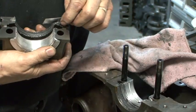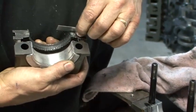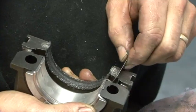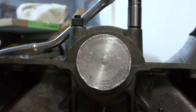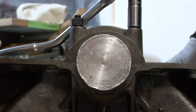You can see Shane's just trimming the excess away from the parting face — you need to do the same thing. Shane's put our mandrel back in; in your case you'll put the crank back in. He's pulled the tension back down on the studs or bolts, whichever you're using.